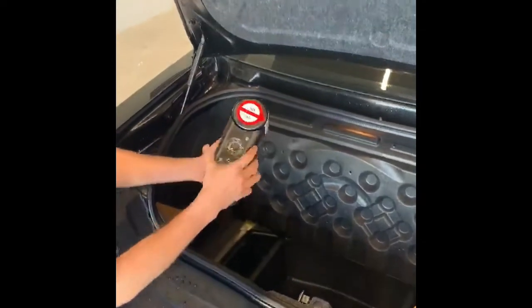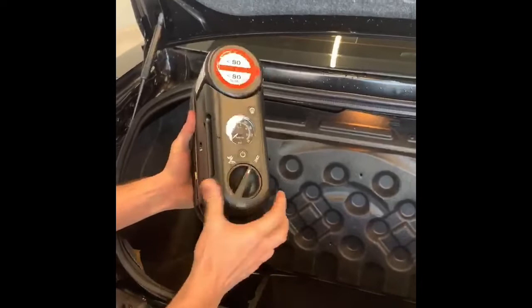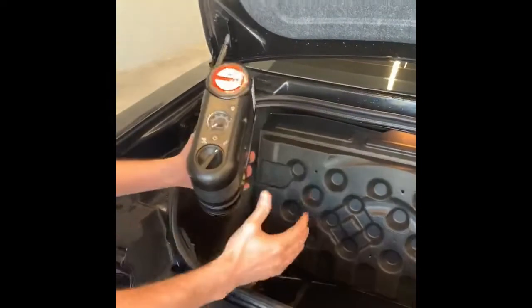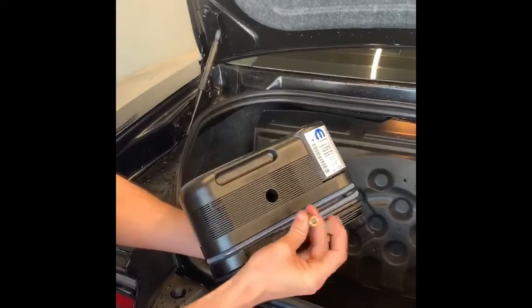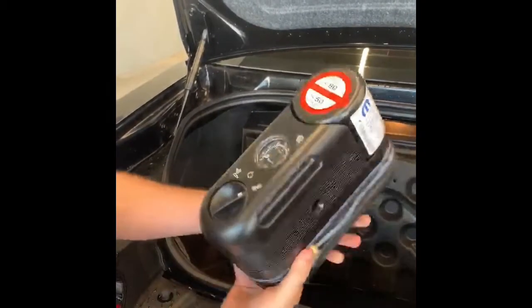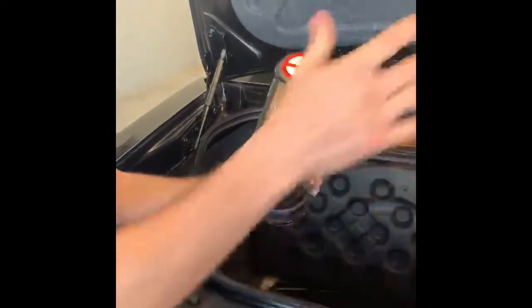So if you do have a flat, it'll have two options — just air or fix-a-flat — and you just rotate this here. So this is just if you need to air up the vehicle, just need more pressure? Correct. Now if you actually have a physical flat with a nail in it and it needs fix-a-flat, you'll hook this up, screw this onto the valve stem of the tire, plug this into the 12-volt charger here, and power it up.